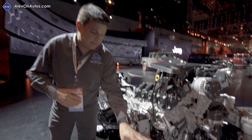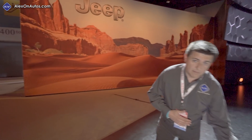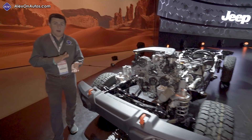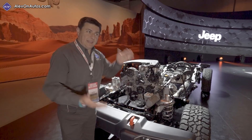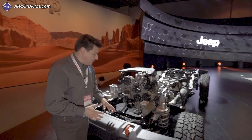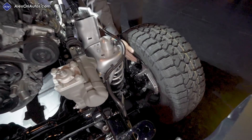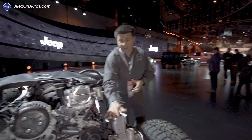We also get different spring seats, reinforced components for the front springs, and hydraulic jounce bumpers rather than the regular rubber jounce bumpers found in a lot of vehicles. Because when you're out on a dune, you're really going to be bottoming out your suspension relatively often, and these jounce bumpers help manage that last motion in the suspension — so instead of a really hard shock into the cabin or frame, they soften that blow. They've also beefed up the front suspension components; for instance, we get steering knuckles that are cast iron and larger than in the regular model.